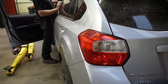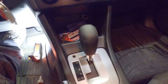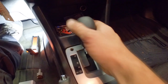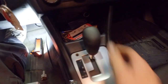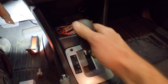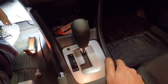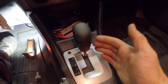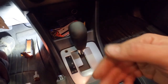We do have brake lights — they're lighting up. I'm going to turn the key on. I can feel the clicking in here and it does go into neutral. To make sure the switch is adjusted correctly, verify that your brake lights are not staying on, and that you cannot get it into neutral, drive, or reverse without hitting the brake pedal. You have to make sure it requires pressing the brake pedal to move the shifter — otherwise somebody could bump it when you're not expecting it, drop it into drive or reverse, and run somebody over. You don't want that.